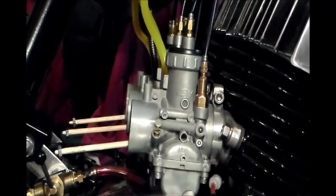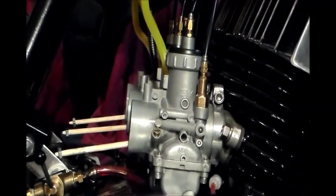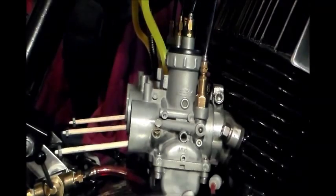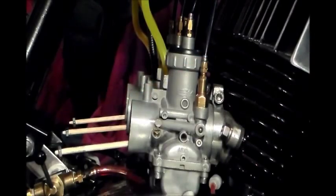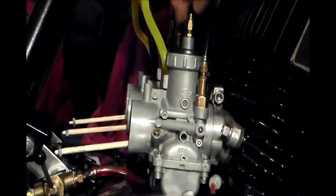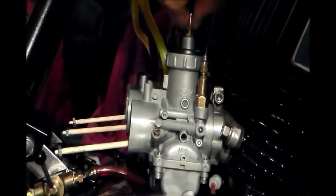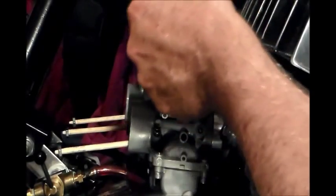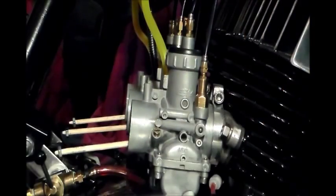Now, let's see what we got now. Okay, you can see that I gotta be very gentle with the throttle. So we can see number 3 is moving first, and 1 and 2 ain't even going anywhere. Okay? So all we're going to do is I'm just going to back this out until I pick up. Oh no, I'm sorry. I'm going to let that in. I want it to start later, to try and pick up another one.